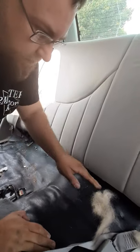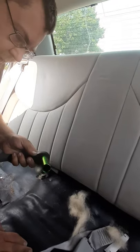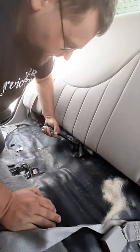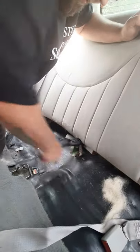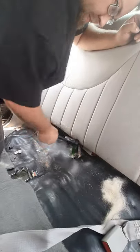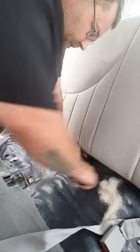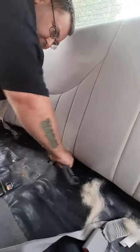So there's four of them all along the back here. They're 18 millimeter. You want to make sure you've got a deep socket to get on these. You just want to crank them suckers out — it's going to be pretty tight for the first half. Actually, it's going to be tight the whole time; they really don't want to go anywhere.